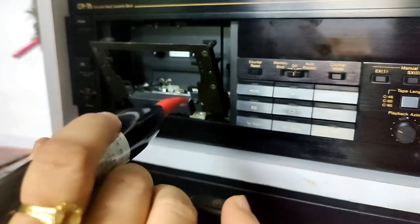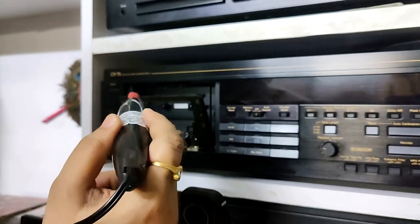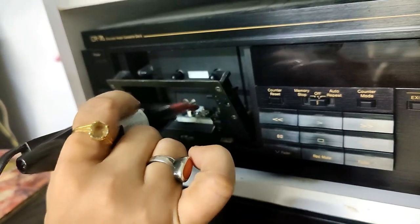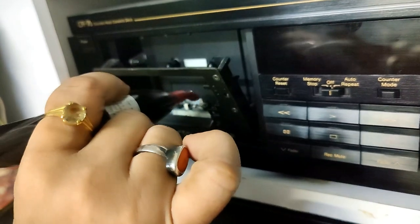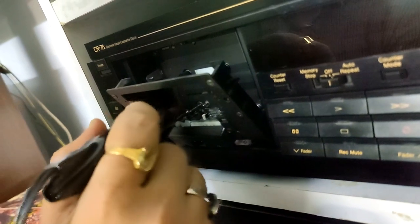Now I will show you this once again. I won't plug it in, but I will explain how to move the wand inside the cassette door so you understand it clearly. This is my deck — I have removed the door so you can see the path well. The wand, when plugged in, carries current and you will see a slight vibration. Take it very carefully inside and do circular motions on the head. Then do the capstan — do circular and anti-circular motions for eight to ten times. You don't need to touch it or scratch the capstan. I will also demagnetize the tape path guides, as they also touch the tape.